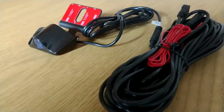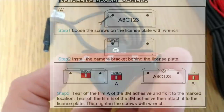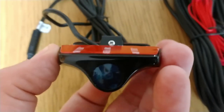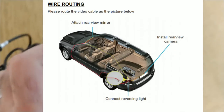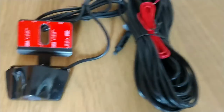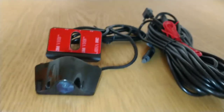There is a degree of flexibility as to where you can put the rear camera. It would be ideal for a van if you can't see out your back window. You can use it as a reversing camera to fix behind your registration plate. The back bit does detach if you unscrew it so you can stick it wherever you like, but you have to keep it this way around because there's no way of flipping the image from the camera. You can use the red wire to wire it up to your reversing light so that when you put it into reverse a parking guide comes up. It will still operate as a rear camera without having to wire it in.